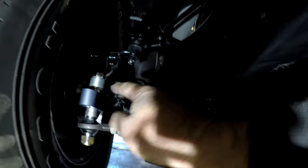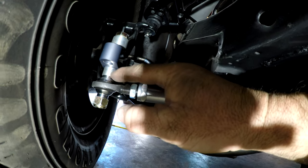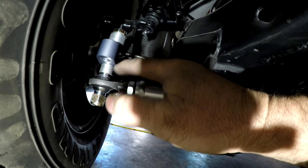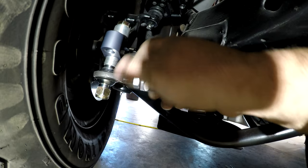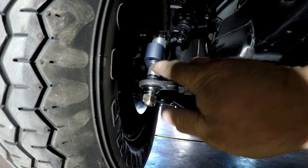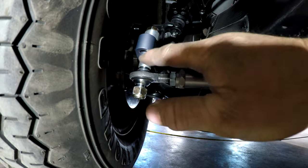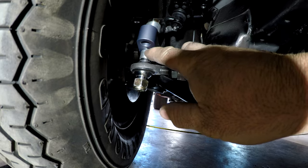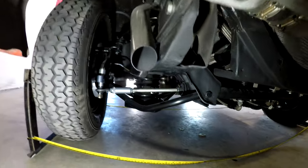Pretty much what you want is to draw an imaginary line from the frame mount to the ball joint, and you want the angle of your tie rod to match that angle. For adjusting bump steer, it comes with all these different spacers and washers - you just combine them and move them around to get your bump steer where you need it. TRZ also has two holes in the steering arm - one further back, one further forward. The further forward one is more for racing, this one is more for street because it gives a little more steering angle.